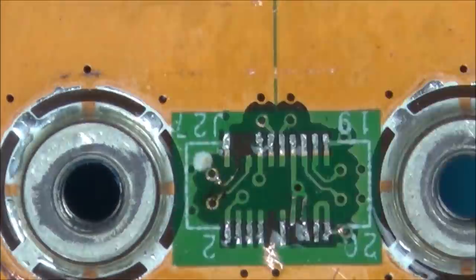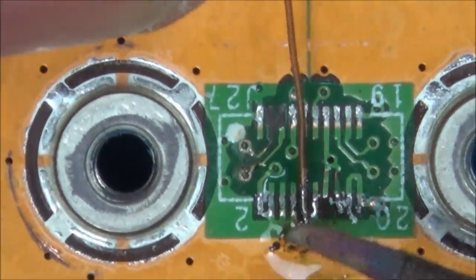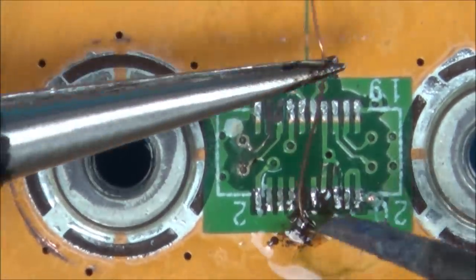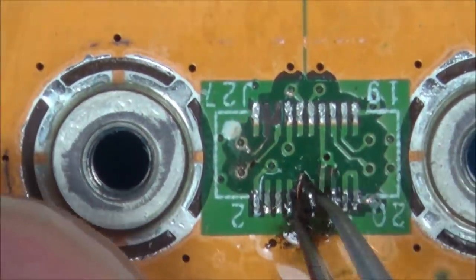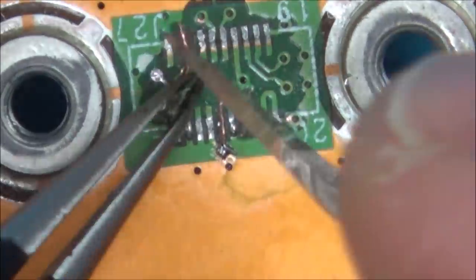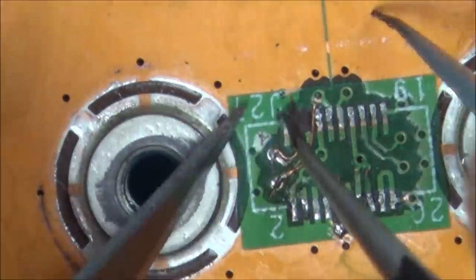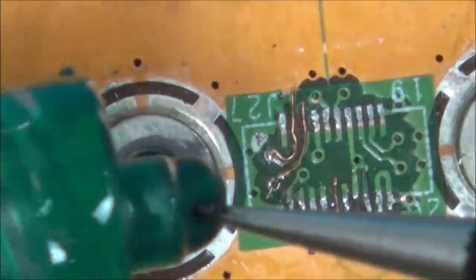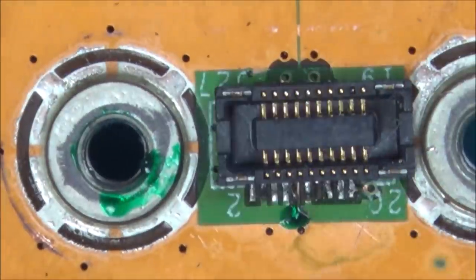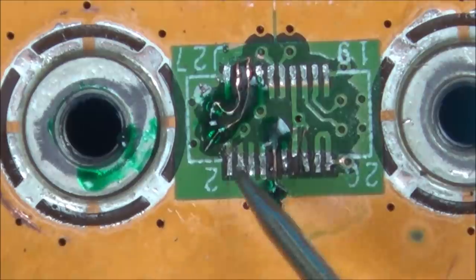The problem then came is that with the UV mask and the enameled wire that I ran, even though the enameled wire was 0.1 millimeters, which is tiny, that's right, 0.1 of a millimeter, it was still way too big, especially with the solder mask, for the connection to fit on. Like the Lego connection, it was raised too high. So I couldn't get any of the pads to solder. So I was having a complete and utter nightmare with it. And then unfortunately I had to give up.